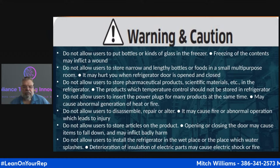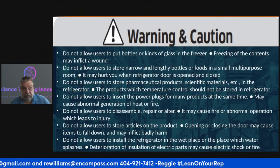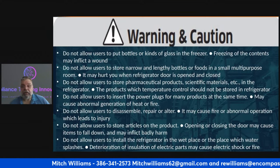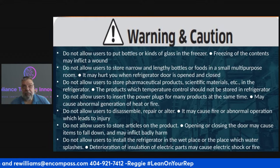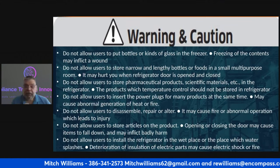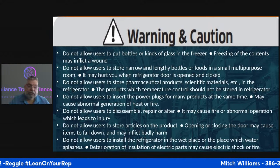Do not allow users to disassemble or alter the appliance. I ran into one where a lady had the refrigerator on a hundred-foot extension cord — you can't do that; it runs the risk of shorting out the board. Don't put stuff on top of the refrigerator either — it's not safe and it inhibits airflow. If you open and close the door a couple of times it can move items stored on top forward, and next time you open it they drop on your head.